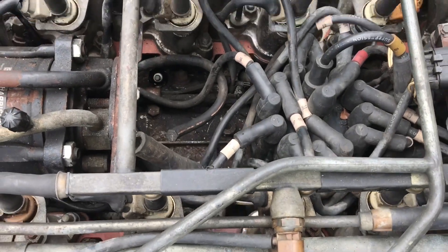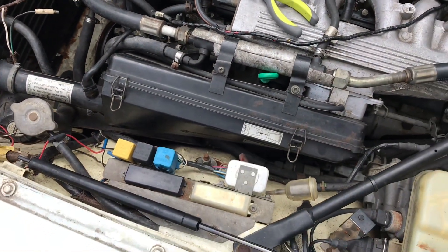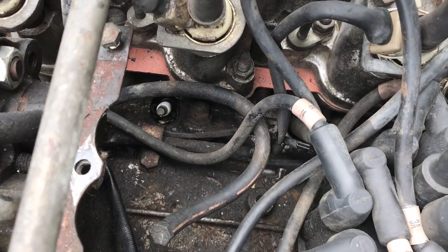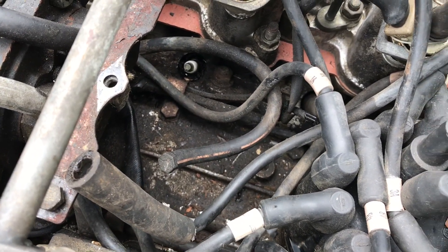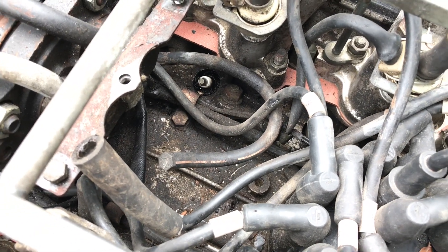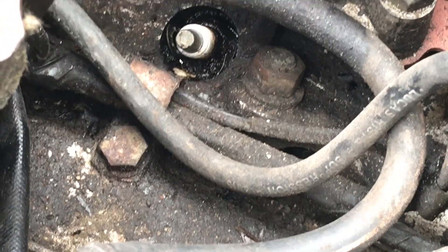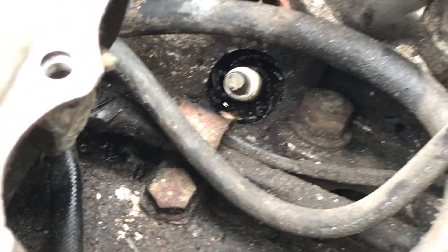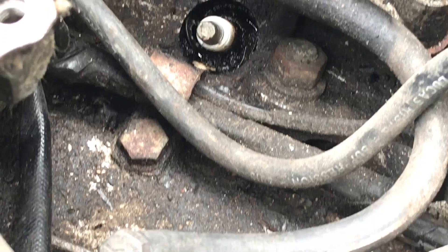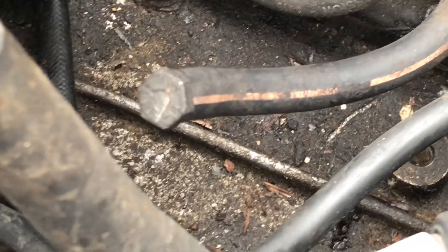I cut the actual wire — I don't have any need for the cruise control. I know this is probably not the best way to do it, but I just wanted access to the V and I removed it. Out she comes. I'm inside the V now and inspecting everything. I can notice a ton of sludge — it's just caked on there entirely too much. The top of my spark plug was barely connected; with little to no effort I removed that boot and I see a bunch of crud and debris in there. That stuff is nasty — that spark plug is completely submerged in this stuff. Before I do anything I have to clean all of this up. All this sludge is no good. I'm trying to do it right, so by the end of this I'll have a nice clean V.